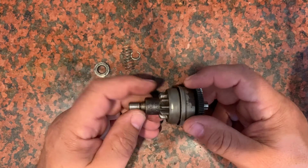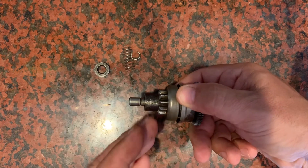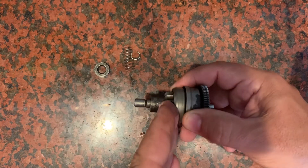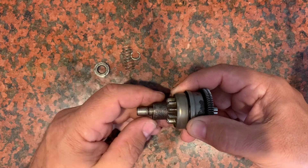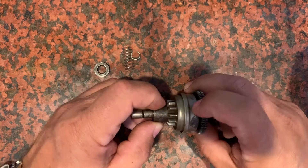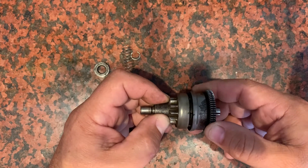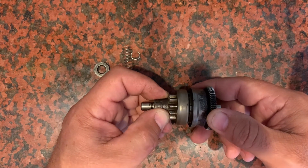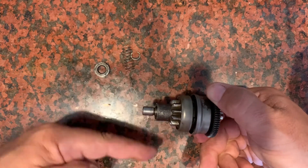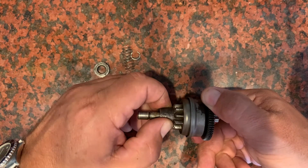This whole thing is all very rigid at this point and it's turning that flywheel really hard. Then two or three cranks of your engine with the flywheel turning will start to spin the flywheel faster than the starter is spinning the Bendix. If I hold this firmly and spin the starter, it comes out and contacts the washer. The whole thing is turning now, turning the flywheel. But then as the flywheel goes faster than the Bendix, watch what happens when you turn the Bendix that way — it retracts.